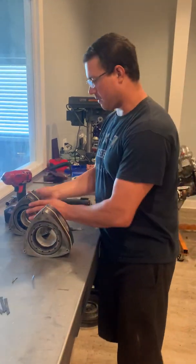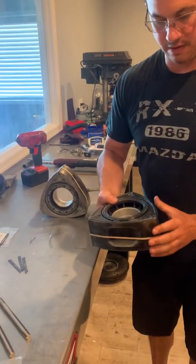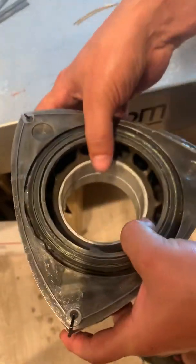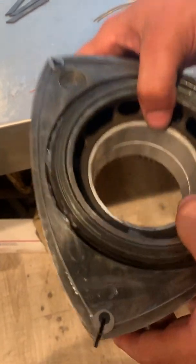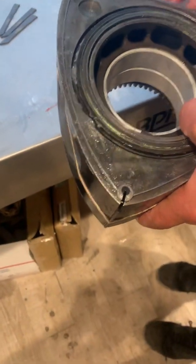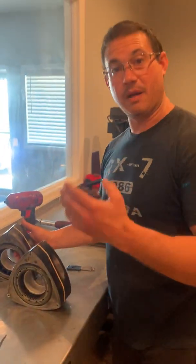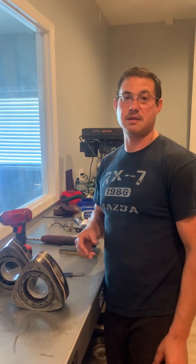Then you just move on to your next rotor. And when you go to drop it in, all you do is hold it like this and literally just push in like that. Get your piece set, hold it in just a little bit, just enough. Then once you get it halfway in, the apex seal is being supported by the rotor housing. Then you can pull your rubber band out and just drop it in. Easy — that's how you put apex seals in with rubber bands before you get to the actual drop-in process.